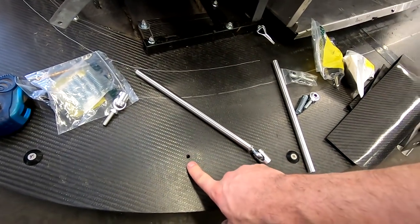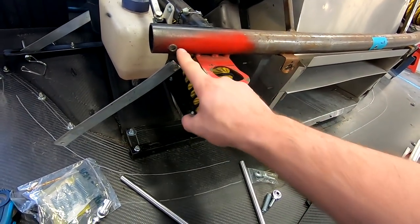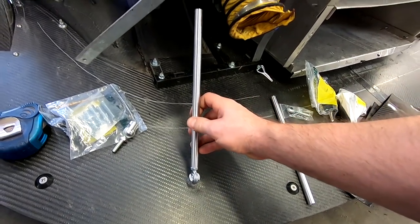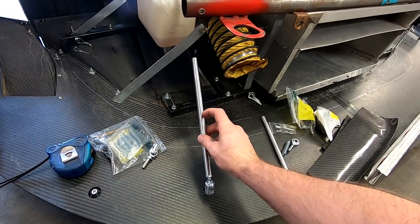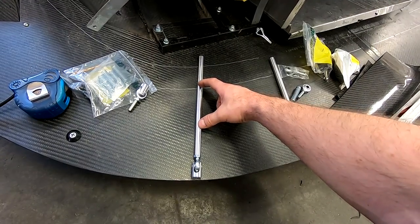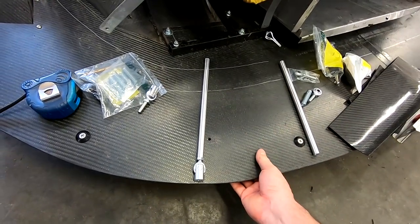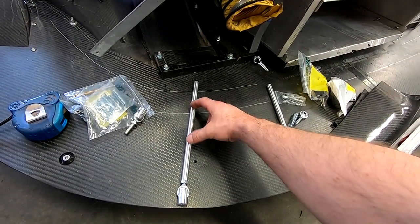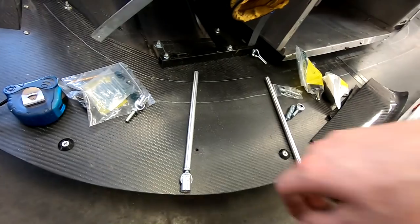Here you can see our original hole in the splitter. At the track we put some nutserts in our crossbeam and ran some steel straps, but as you can see these are much too short. What I'm going to do is cut it in half and put a larger sleeve over it that will lock in the downward direction under downforce, but if I hit the curbing or go off track it'll give upward a little bit. The space between the sleeve will allow that to compress.